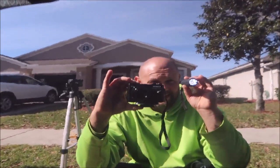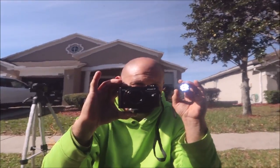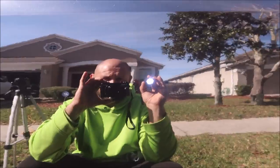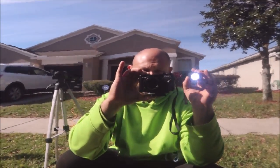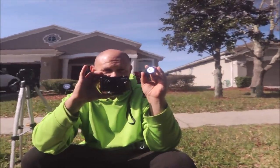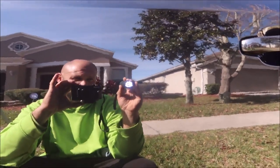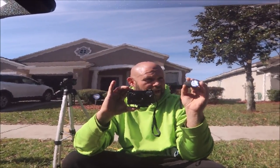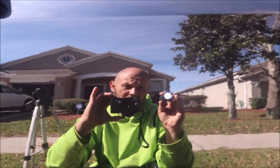It works fantastically. I would say it will work the absolute best with the orange Buff and Shine foam that I sell, the European foam, or the red applicator pad that I sell on detailjuice.com. That pad actually doesn't have any mechanical ability, so you're letting the polisher and the polish do all the work. But on these harder paints, like this is Dodge Chrysler paint, and it's usually pretty hard.